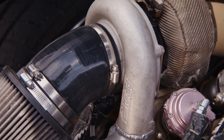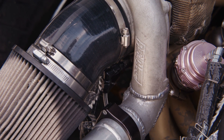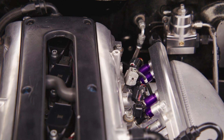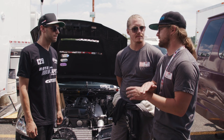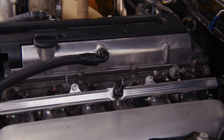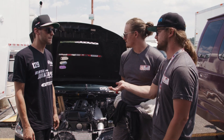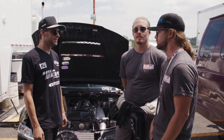So that's a precision turbo — what size is that? 6466. Is it a three liter? Yeah, still three liter stock compression. You have dual injectors for each one of the cylinders. What's up with that? We get a real nice idle off the thousands, and then basically as we're transitioning into boost, it starts bringing the 17s in, and they both equalize out at about 40% injector duty. We have tons of room — we got the EGTs and everything, so we can add 60% injector duty across the thousands and 17s in case anything goes weird.